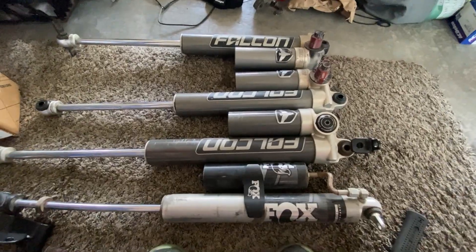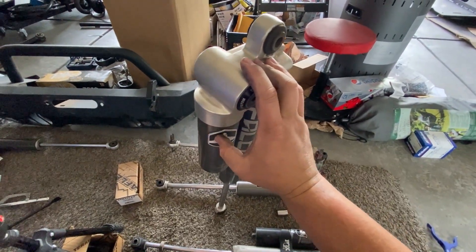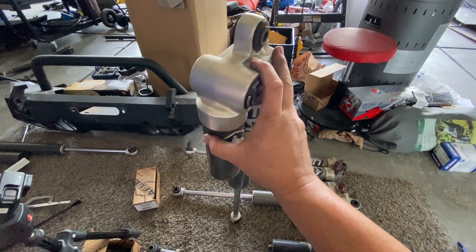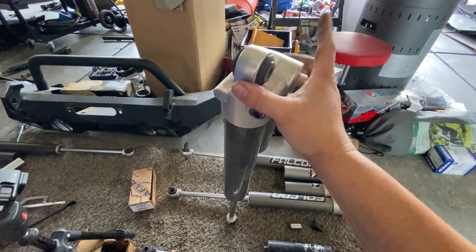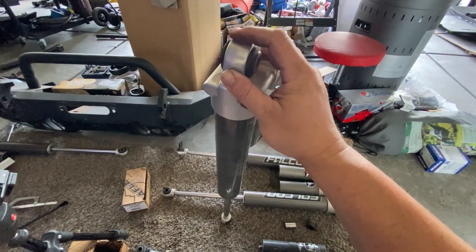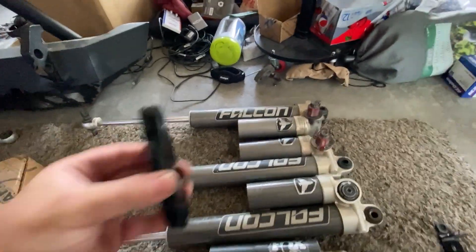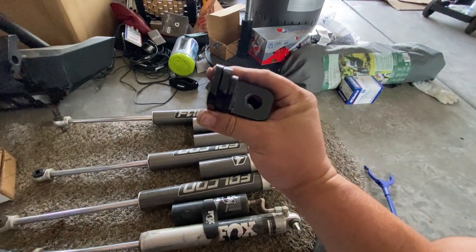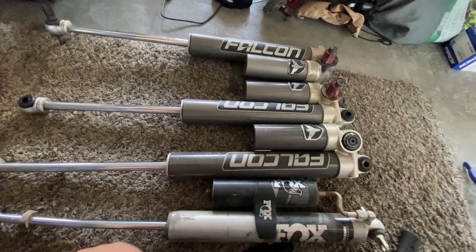It's flipped and it's like this. If you watch my videos, I've got a messy garage right now. This is facing back towards where the exhaust would be up top. Now, because the new gas tank I got from MotoBuilt's in the way, I had to rotate these 180 degrees and have this towards there. There was a bunch of bracketry in the way which I cut away, and I still had some issues. What I needed to do was drop this down a little bit to get my clearance on it. What I chose to do — I made these quarter-inch thick pieces to add to this, giving myself an extra half inch of clearance by bolting through.